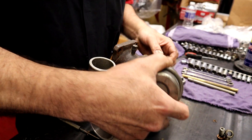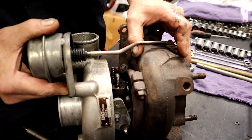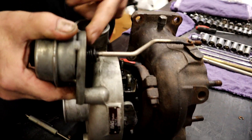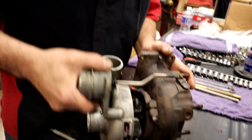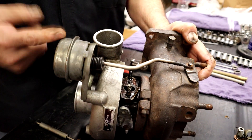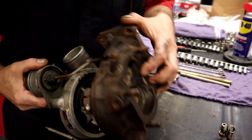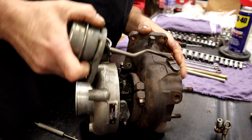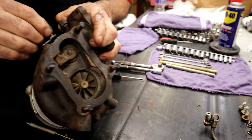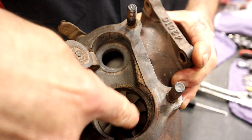I'll pop off the clip and there it is. When you put it on, you can even see that there is load on it — it's already got a preload on the wastegate. It's spring loaded, so it's working against the spring and it's working against boost. The spring and the boost are all working together, and you can see it's preloaded to keep that valve shut. Once we unload it and get rid of the valve, now we can see the big hole that's going to bypass spinning the turbine.